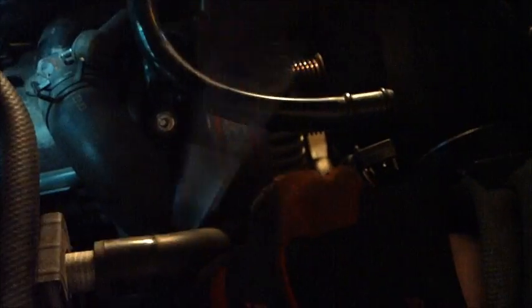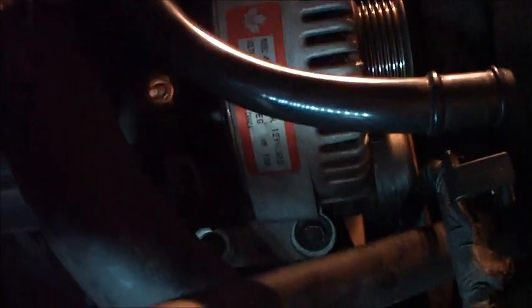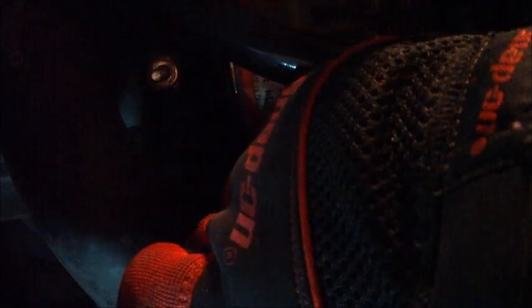Okay, now it's just the main bolts. Alright, the 2 on the bottom are a 1/2 inch. Once you get them loose, go ahead and turn them out. Leave the top for last so it's easiest to get to. Another 1/2 inch at the top. I use a deep well on that, or you could use a box wrench.